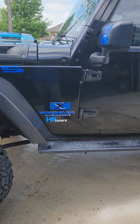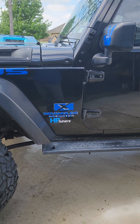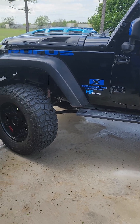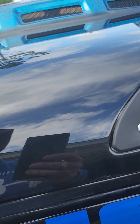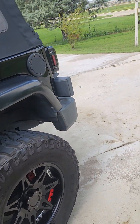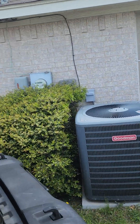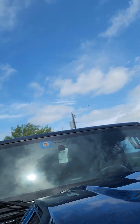It was down for about four or five weeks. I went on vacation, came back, dropped the body back on it Sunday night, and drove it to work on Monday. I'm pretty intimate with this Jeep — I know it pretty well. I drove it and had problems with a P2138 code, which is a throttle pedal assembly code problem. What it is — the GM plug is kind of faulty. It's only a five-volt signal and it loses signal for just a few milliseconds, throwing that code.